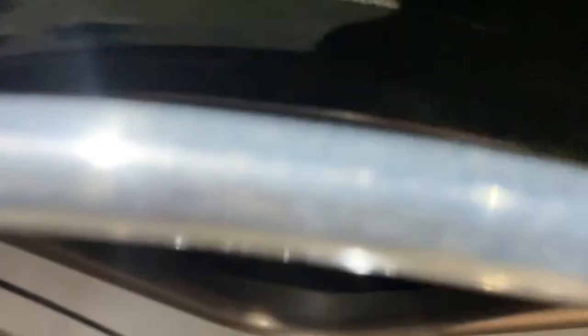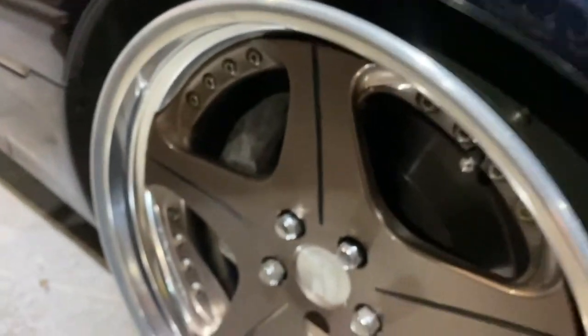The rears are actually perfect - sitting just kind of above or just slightly in, so whenever I put a tiny bit more camber on it should pull it in perfectly and sit at a nice height, good for driving. The front on the other hand - we put a five mil spacer on and you can kind of see in there, it is hitting the brake caliper.